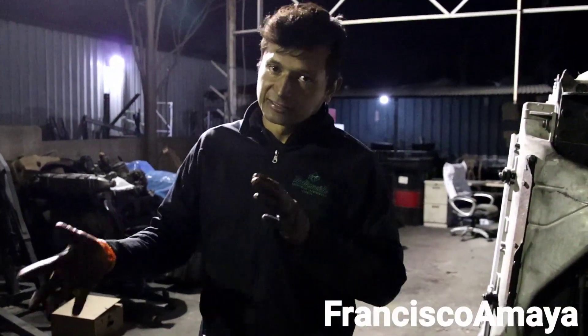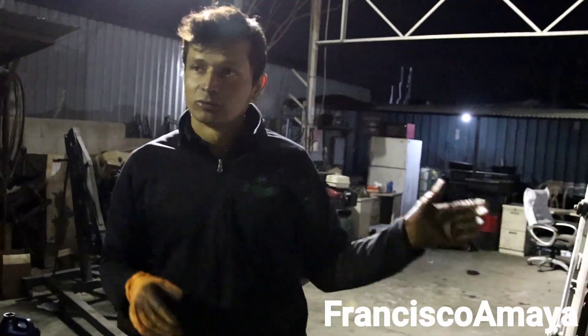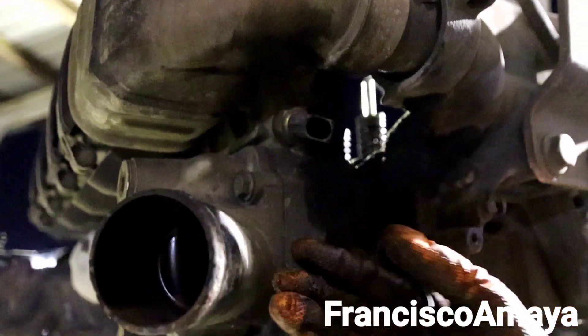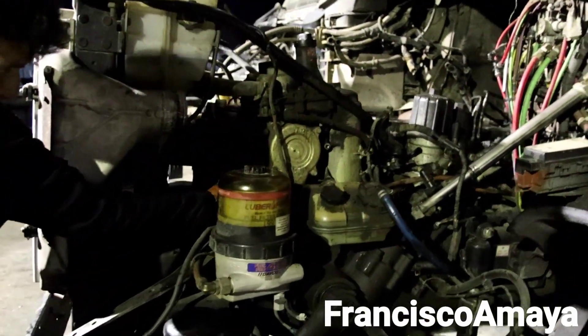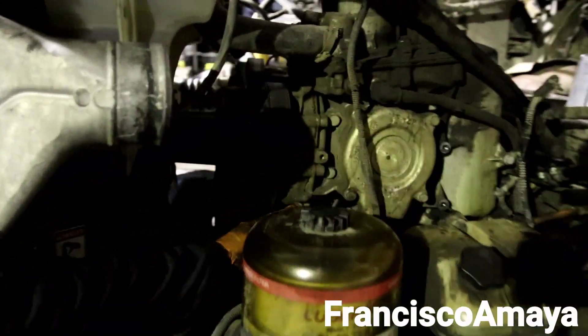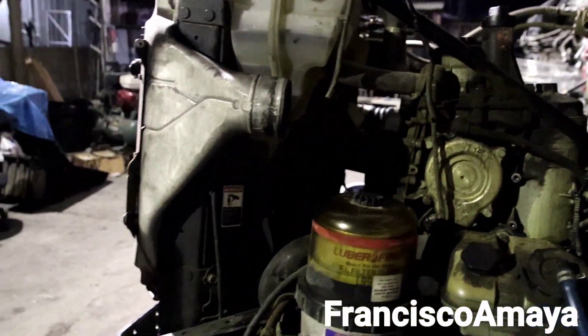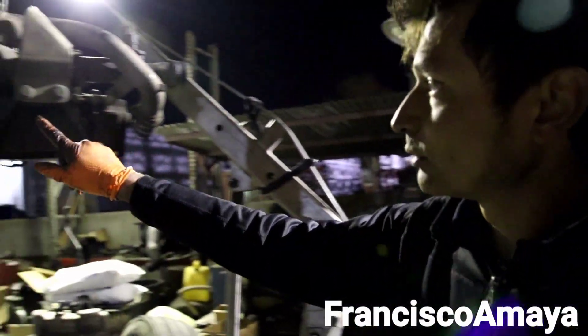What this does is the engine calculates how cold and how hot the water is leaving the engine. This maintains a nice temperature. The engine fan usually works with this one right here — this is the one that measures the hottest water, because this is where the hottest water is leaving to the radiator, and then it goes down from the radiator back to the thermostat and to the other temperature sensor that reads the lower temperature of the engine.